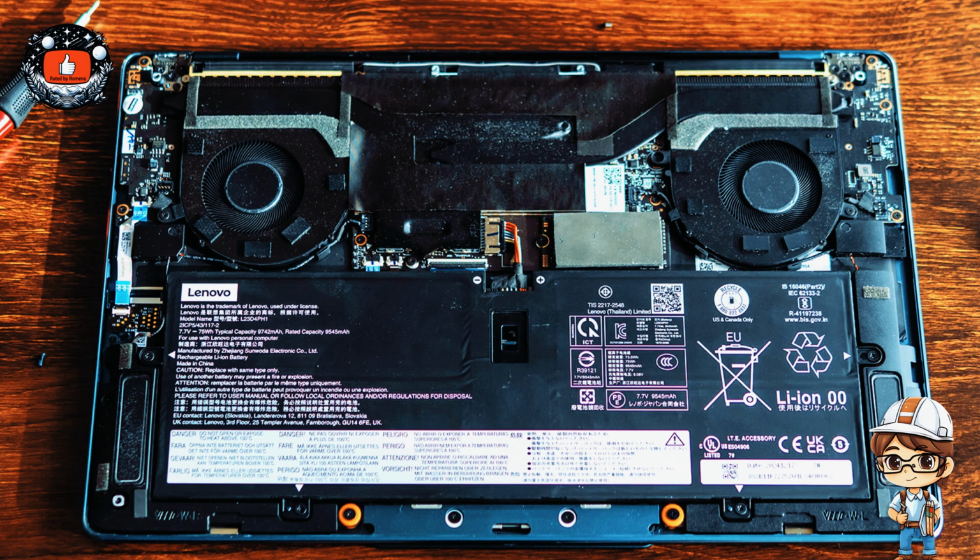However, for those unfamiliar with this design, overlooking these hidden screws could lead to damage when attempting to remove the bottom panel. When reassembling the laptop, that foot fits back in with hooks. I'm not sure it would survive a bunch of openings, but once or twice should be okay.